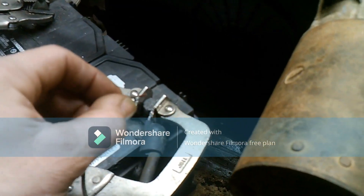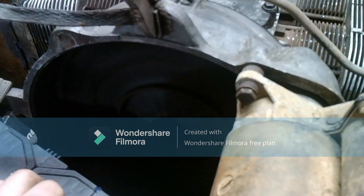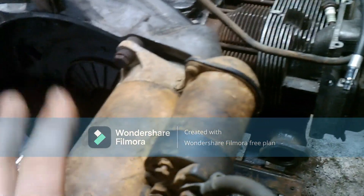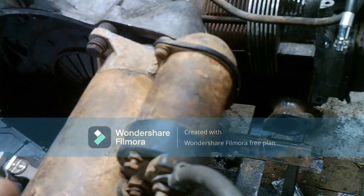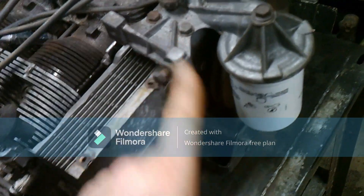What I'm fixing to do is a compression test. I'll show you that it turns — this is hard to do and watch the camera at the same time. This might not be spaced quite right but it's enough to turn the engine, which is what I need. I have already verified this thing's got oil pressure — how good, I don't know, but I know it's got it. Initially I was turning it by hand before I put the oil cooler on permanently. There are two holes right there; when you pump the oil it comes in one side and out the other — in this case it comes in the bottom and out the top.